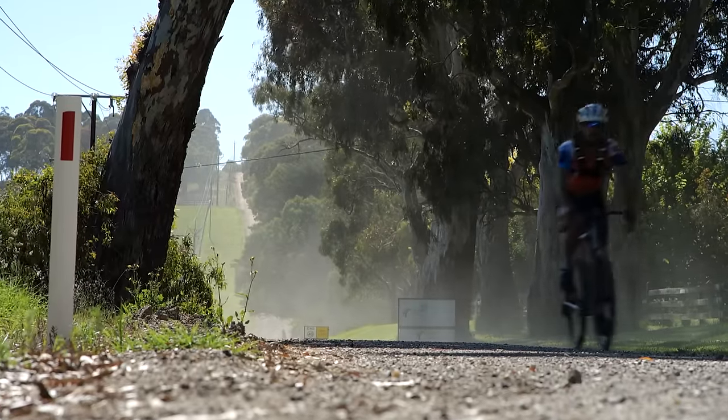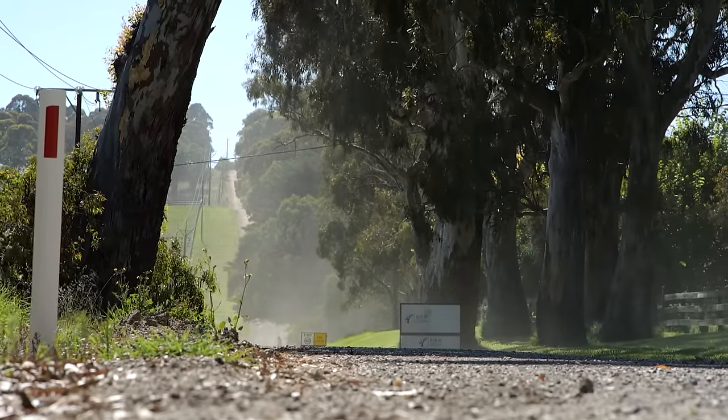Even for road cycling there's going to be airborne dust, and that airborne dust is completely exposed. Anyone can do this test if they're game: remove the seals off your wheel bearings and bottom bracket bearings, go ride around for a while, and see how the bearings are feeling — actually, don't do that. They simply will not remain feeling silky smooth; they're going to have crap in them, running rough and notchy, creating high friction and high wear.